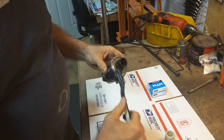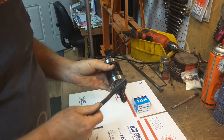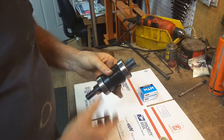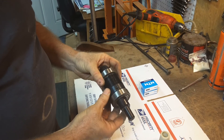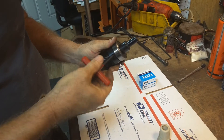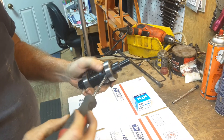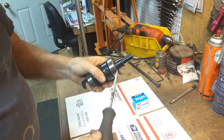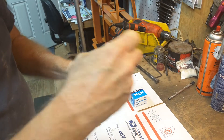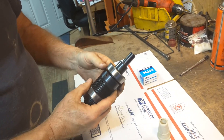Then do some cleanup, because there's already enough friction involved that you don't want to be pushing bearings across rust and accumulated dust. So we'll do a little cleanup before we move over to the bearing press. A lot of times you have to loosen the set screw so that you can get your bearing separator underneath the bearing and slide it back and forth to get a gap.